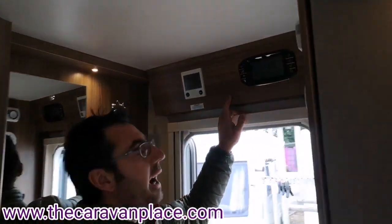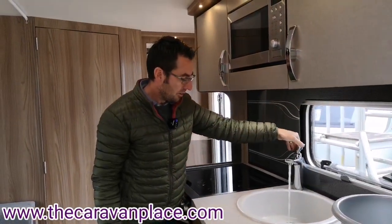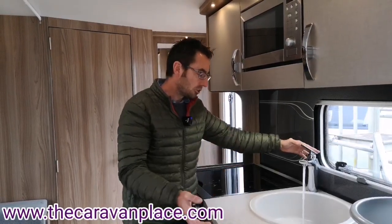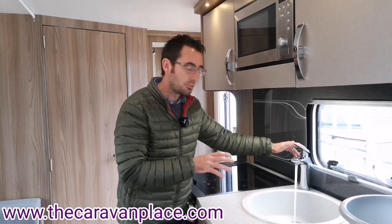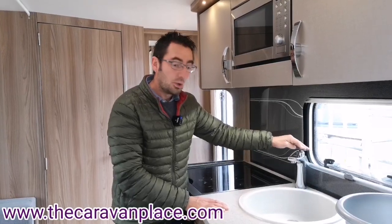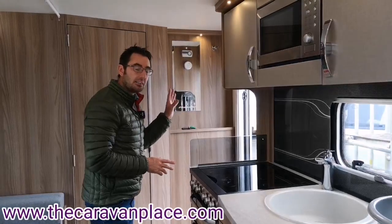Just above the door we can put our water pump on — literally just press the pump button, you'll hear it kick in, and then we get water through the system by turning the taps on. If we've drained the system down it's going to take a good five minutes or so to get all the air out and get a nice steady flow of water. It will be coughing and spluttering for a few minutes, and once we've got a steady flow on the hot and cold we know the system is full and ready to use. Do that on the bathroom tap and shower to get all the air out, then we can go ahead and put the heating on.